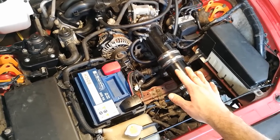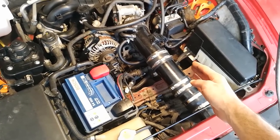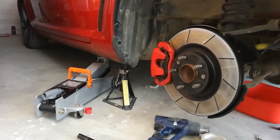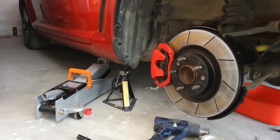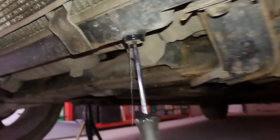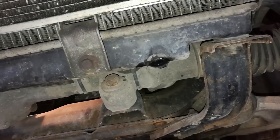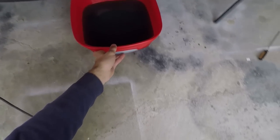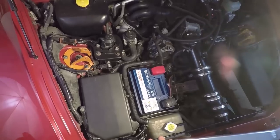Since I don't have the stock airbox, I can't show you how to get it out, but SX Rotary made a great video on how to do it — the link will be in the description. First, jack up the front of the car, put it on jack stands, and remove the passenger side wheel. Slide a pan under your car below the radiator drain bolt, slowly unscrew the bolt and take it out. Release the cap to increase flow. When there's no more coolant coming out, screw back the bolt but don't over-tighten it. Take out the pan and pour the coolant into a 5-liter plastic bottle, then put back your cap.